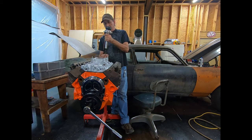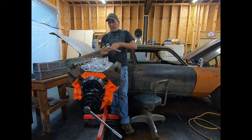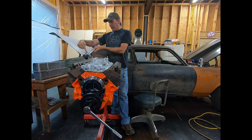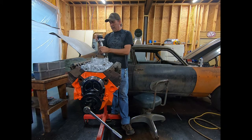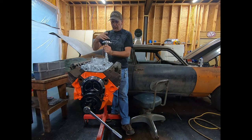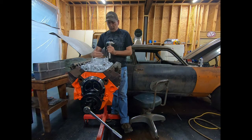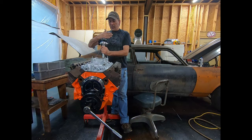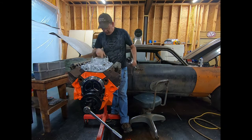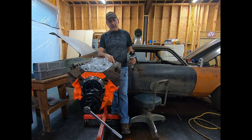Because the shaft mark on the distributor is pretty much in line with the rotor — not exactly, but it's pretty much in line. You can kind of hold it up and look at it. On an HEI they're usually a lot closer; this one's way off. So if I want to be right here on my number one, then I want to look at my shaft on here and see that it's going to be turned pretty much towards my number seven cylinder. So I want to look down here, see where the oil pump shaft slot is, and turn it to right here.